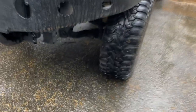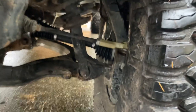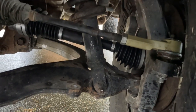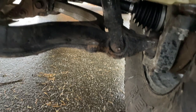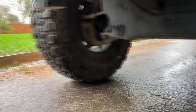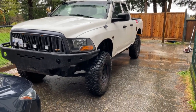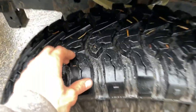The beast is back on the road — new CV in, tie rods in, uppers in. One tip: my brake cable was super tight but I was able to jam the axle down into the hole without removing the bottom ball joint bolt from the knuckle — just used a bit of force and it went right in. It seems mint. I've got the Cardone heavy duty on one side and the Track Motive more-travel on the other — kind of a little comparison to see which lasts longer.